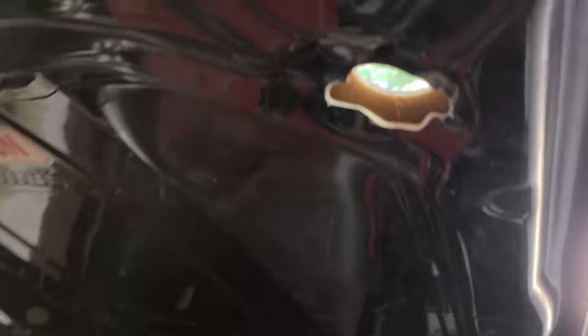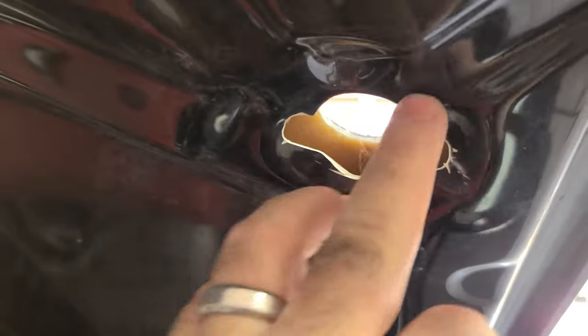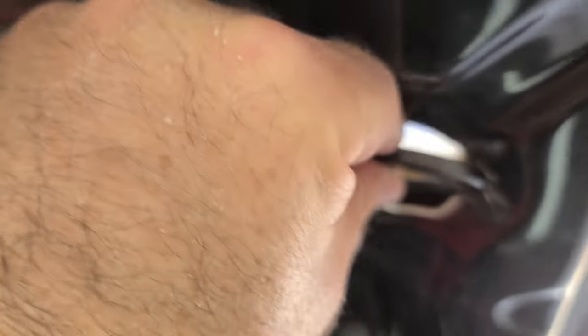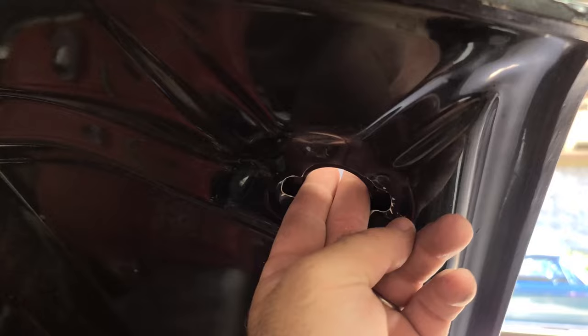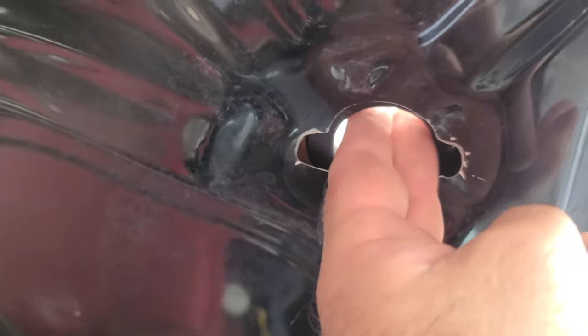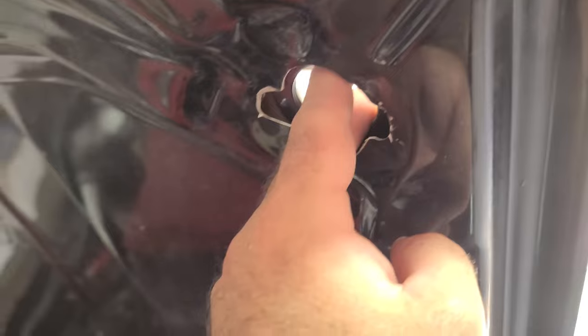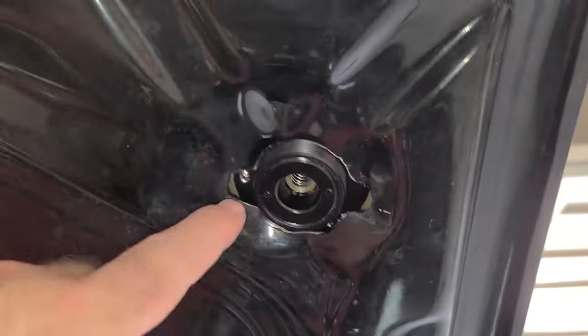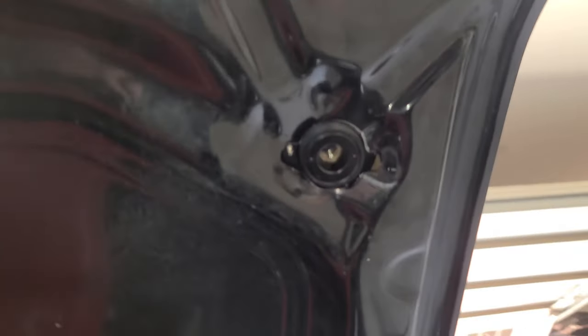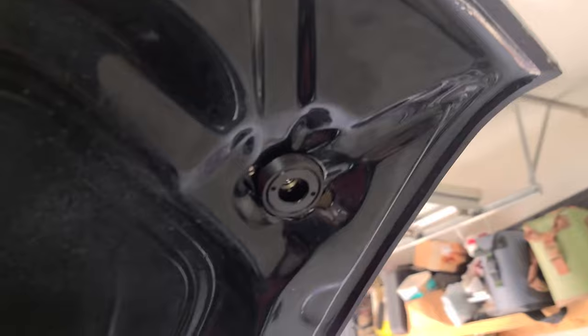So the next plan: instead of cutting the whole circle out, I cut it just wide enough to fit this guy in. As you can see, I could slide this washer up in there very carefully. So then that's the only thing — those two sides going through. And if you look, you need to have access to that anyway to put the locking pin in. So that kind of worked out and it should reduce how much shows on the underside of the hood. That's with it installed — I like that look a lot. You just have these two small openings to slide the washer through rather than the whole big hole cut in that diameter. It kind of hides a lot of that. Pretty easy to get to one set screw and drive it in.